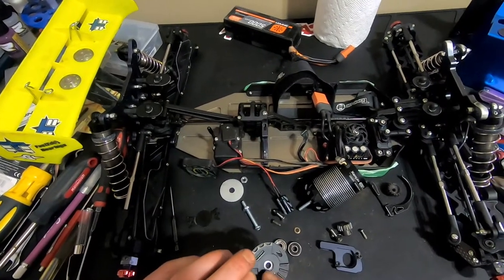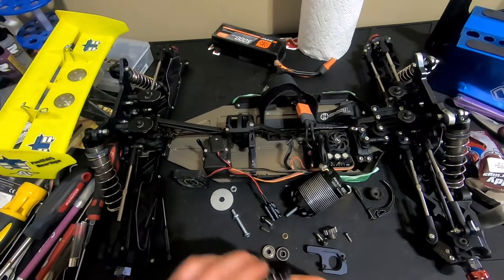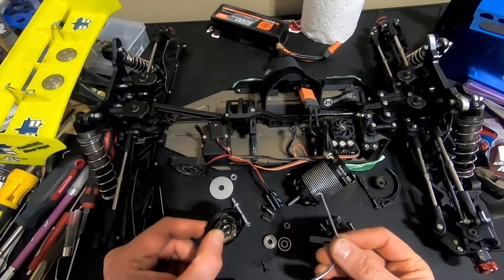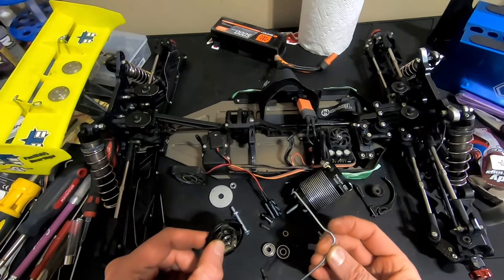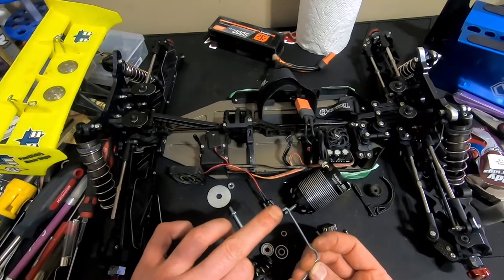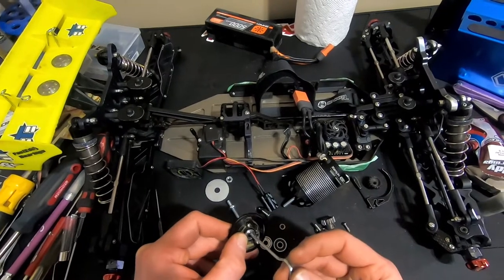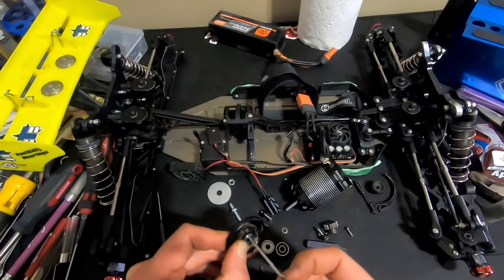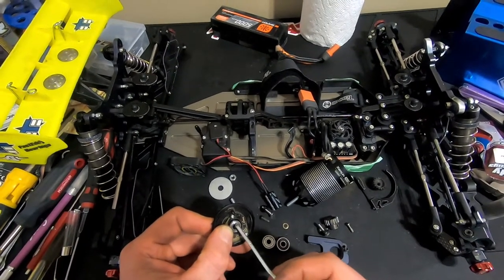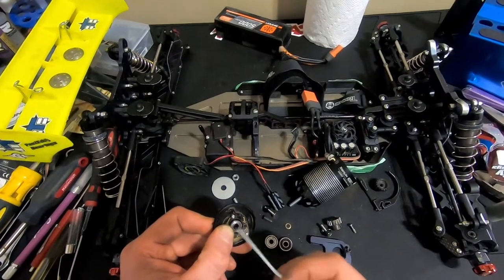This Hobbywing motor — I don't know if all motors have it — but you can actually take off the back cover so you can see the back of the bearing. Most motors you cannot get to the back of the bearing. I had one of these heavy duty cotter pins, put it in the vise, and made a nice little tiny sharp bend on it — ground it down to size so it seemed stronger. I'd get that inside and work around pulling on the bearing, because that's the only way it seemed to work. I've tried bread and the compressed grease gun where it popped the bearing right out, but if the bearing is really stuck in there it doesn't really work.